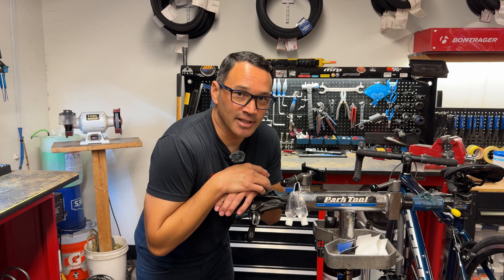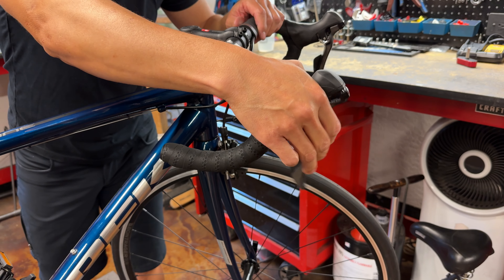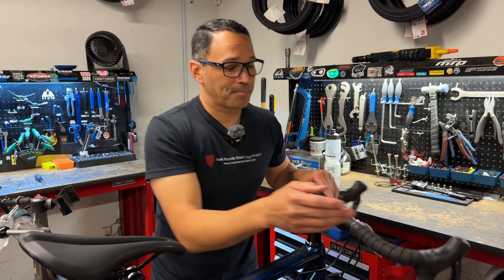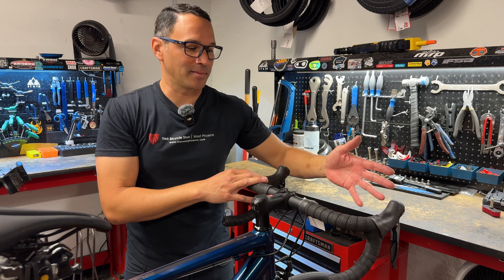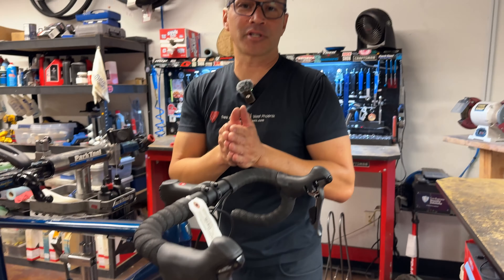The first thing we're going to tackle is if you have a not very snappy lever. You can feel there will be play inside the lever that's not going to feel very good, or it's going to take a lot of effort to depress the lever. You want a nice light action and a very snappy-feeling lever. On the road bike you're going to be all taped up, so it's going to be a little more difficult — we'll have a slightly different approach to lubricating the lines. Friction is going to be our enemy inside these brake lines.